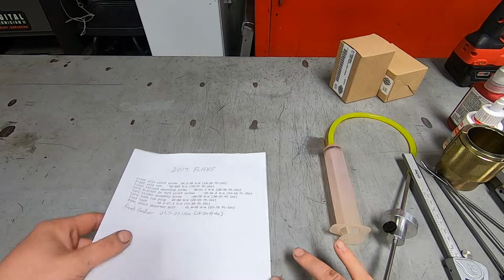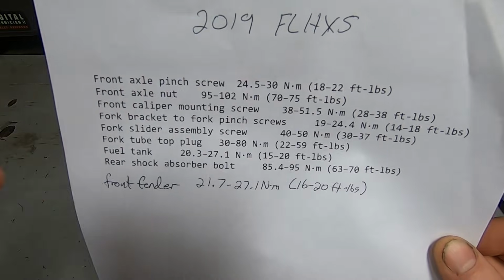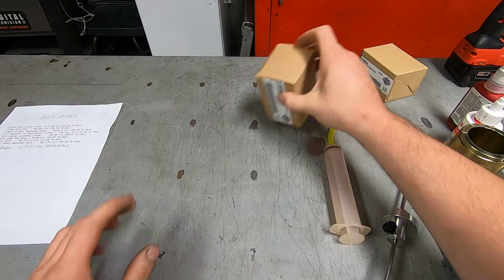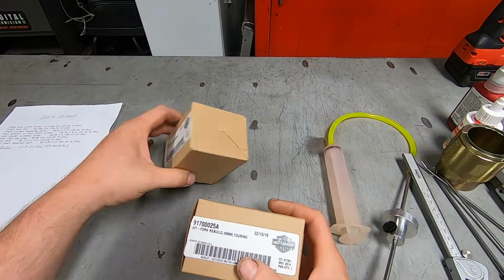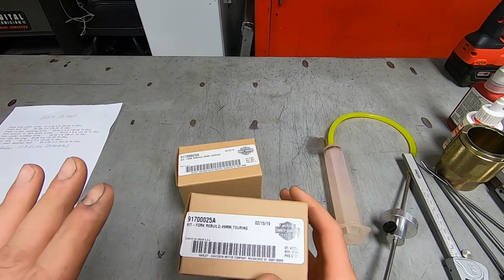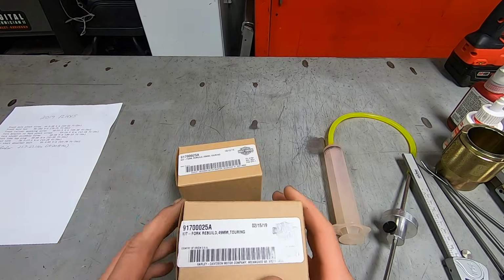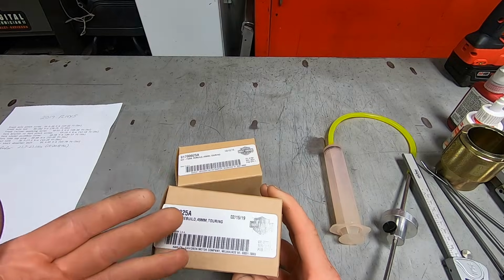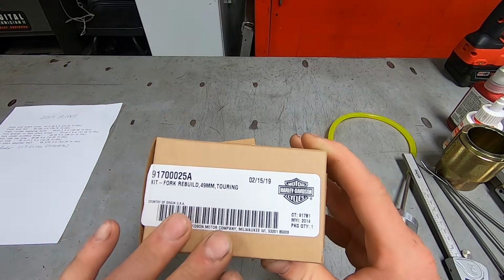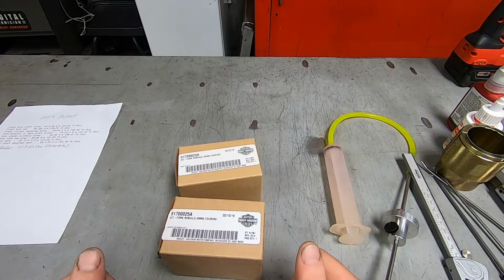But for today, I just did a little quick write-up as far as the torque specs that I'm going to be using. This will also be down in the description if you want to take a look at that, you know, if you're doing this at home. I'm also going to be doing a rebuild on the front forks. I typically recommend doing this, you know, other than a brand new motorcycle. But if the bike has any type of mileage on it, since we're going to be taking the forks all of the way apart, cleaning them, and then installing new components, that way I'm assured that this front fork kit is going to be working exactly the way that it's supposed to be.